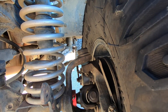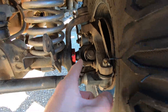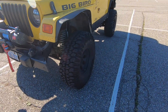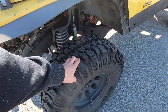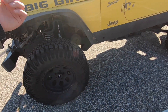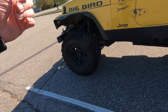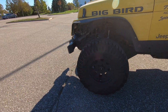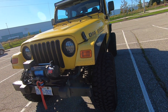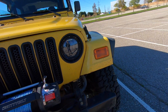That leads me to my next point: heavy-duty ball joints. Make sure you upgrade your ball joints at the top and bottom of your knuckles on both sides, and always keep an eye on them because you'll wear those out a lot easier — your tires weigh a lot more and they're gonna take a lot more strain on your steering components. Anything that has to do with steering or moving the wheels is going to have more wear and tear, so get yourself some upgraded heavy-duty ball joints.